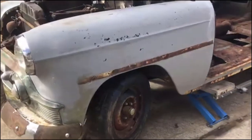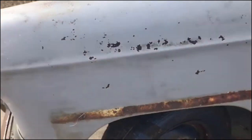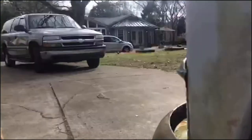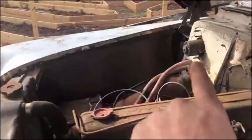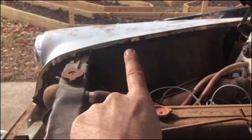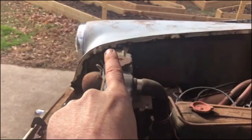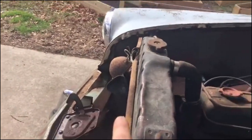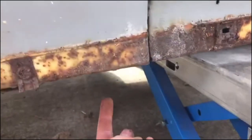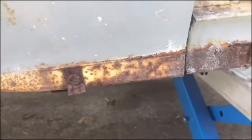So I'll set up a camera so you can kind of see. There's an awful lot of bolts, so let me do a different video. All right, so to get these fenders off, we got to go under here. And there's a lot of bolts underneath the fender well that hold the grill on, those kind of places. We got to get in here. There's bolts all along inside this rail here on both sides. Some of these are just screws that screw in the sheet metal, but that one right there has a nut on the back side, and so does the one on the driver's side. All of these screws have got to come out. These main bolts here, where your shims go, they'll have to come out. Back here on the bottom of the corner, you've got one under here, and then you've got one even on the back side back there. Those will have to come out.